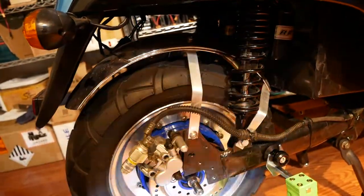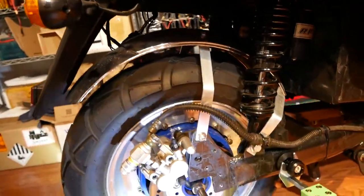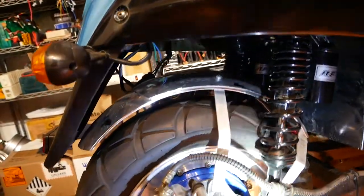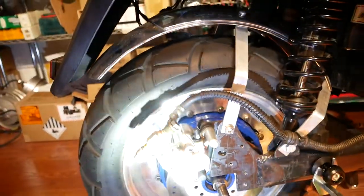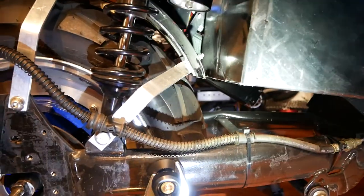What created the problem is the fact that I have much bigger tires — 12 inch rather than 10s. They're a little bit taller, and of course they're wider too. So everything about this whole setup meant that clearances became tighter and tighter and more of a problem. So I fixed it by putting in longer shocks.